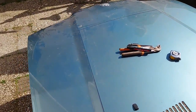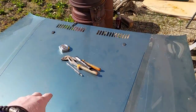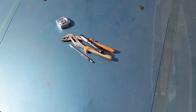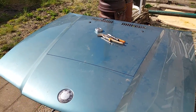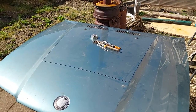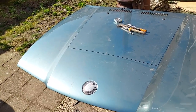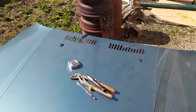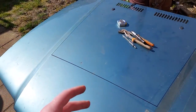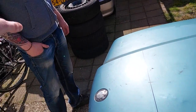As you can see, we've drawn out some lines. I don't want to go with the conventional hood vent with all the fins, because while those are good for letting hot air out and ventilating, for a street car on public roads not stored indoors, water will get in there, get on your coil packs and all that stuff. I don't want to deal with those struggles.